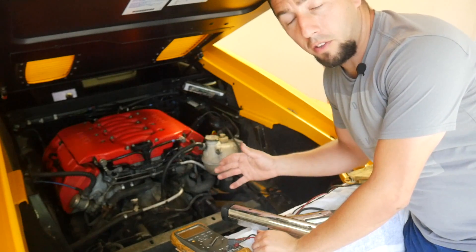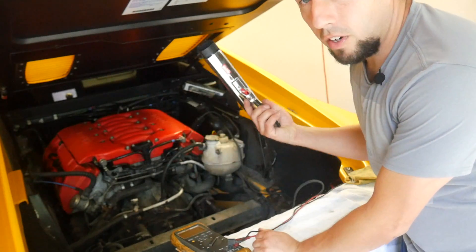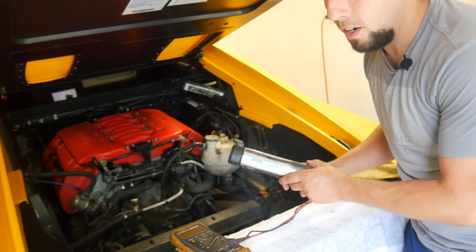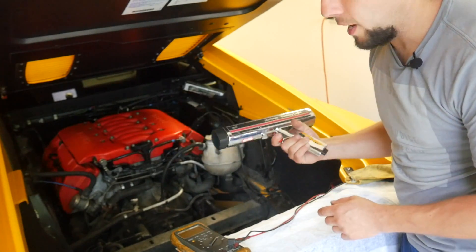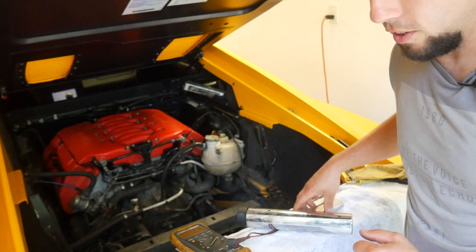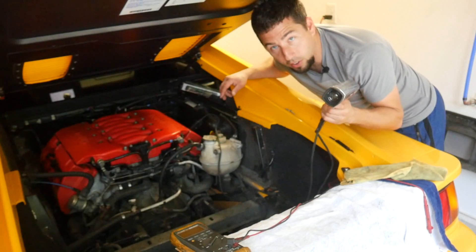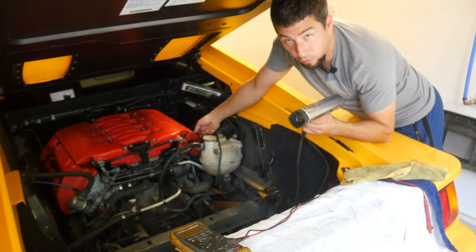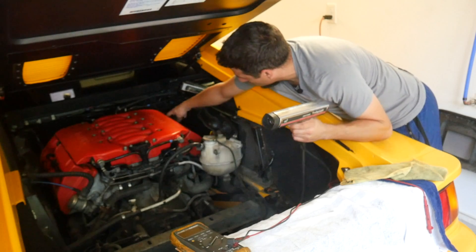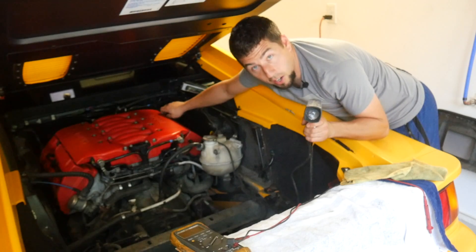To figure out which cylinders were misfiring, instead of pulling plug wires while it's running — which can overheat a coil — I decided to use an inductive timing light. You just clamp around the spark plug wire and if you have spark it will flash, and if you don't it won't. I'm going to start it up on one of the cylinders that's dead and show you it doesn't flash. This is cylinder number four — it has fired. Then we clamp it on cylinder two, which I know is dead. Dead as a doornail.